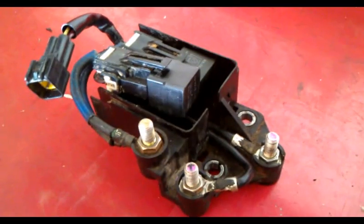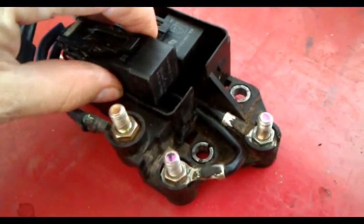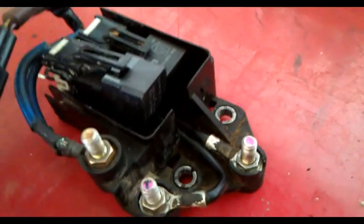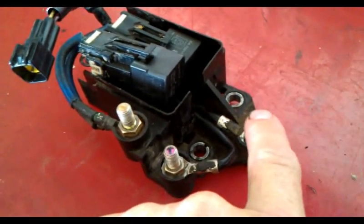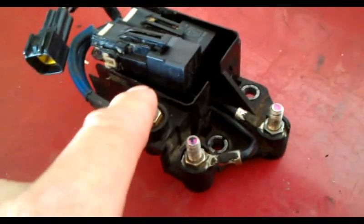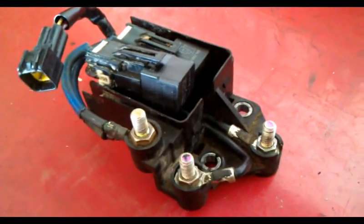This is what that controller looks like when it's out. One relay is for the glow plugs and the other relay is for the air intake heater. One relay does all the glow plugs if your truck doesn't have the California emissions, which means it has a bus bar that goes between the glow plugs. The glow plugs hook up to that one, the air intake heater will hook up to that one, and then your main power coming in from the battery — that comes off that 175 amp fuse — goes to that one.